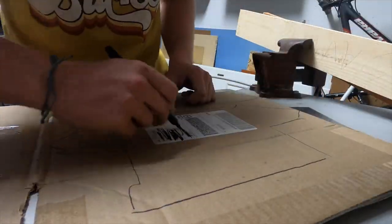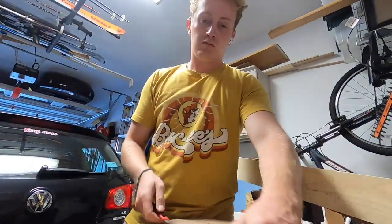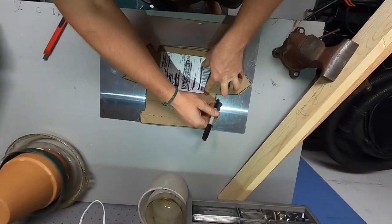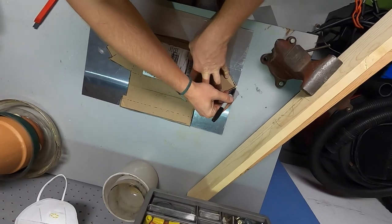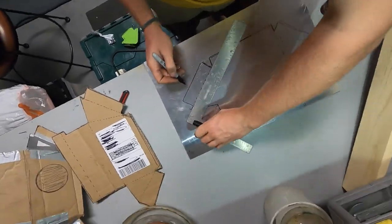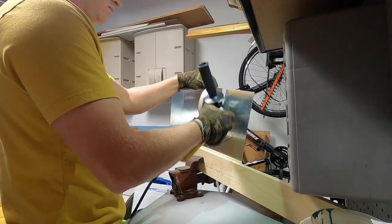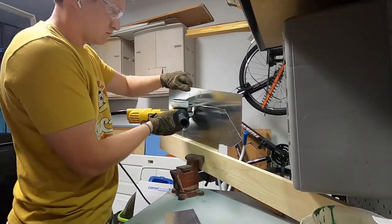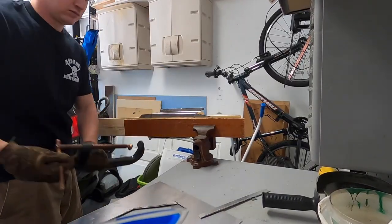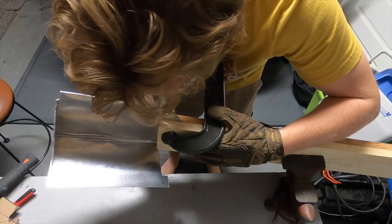Now when we lay it across our metal sheet that we're going to be using, we're going to trace it on, giving probably an eighth of an inch of exterior spacing for the cutting, or the kerf, the area we will lose to the blade. Also, we'll be able to sand away anything later on. You can't really put stuff back on unless you have welding abilities for that. So once we've got it all cut to shape, we're going to clamp it between a piece of wood and another piece of wood in our vise and start from the inside bend out.